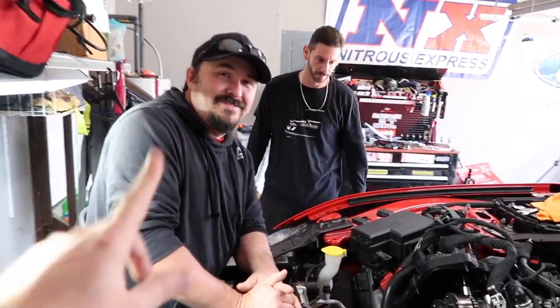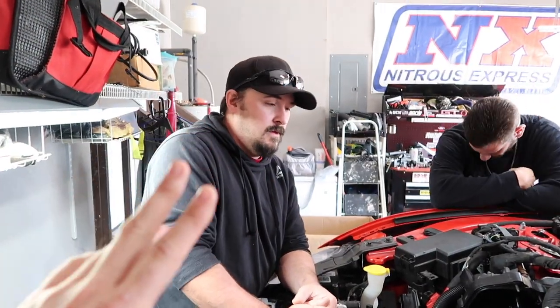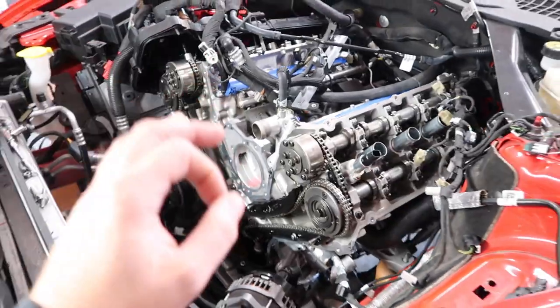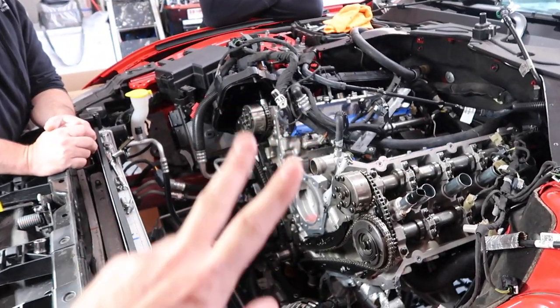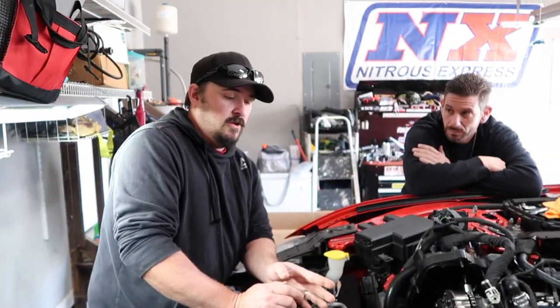Yeah, we'll actually put this on camera. We're actually discussing, he has Speed Addict 731. He's got some totally awesome Gen 1 and Gen 2 Coyote teardown procedures. If you have a Gen 1 or Gen 2, you can reference this video, but also go follow his videos as well. Very well done, because you actually had the engine outside of the car. On Gen 1 and Gen 2, you can leave the oil pump bolted up. So the engine I left out of the car, I actually left the pan bolted up so I can show you how to get to the bolts.